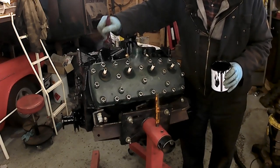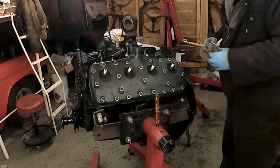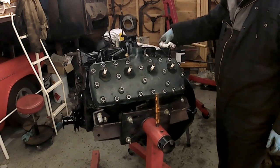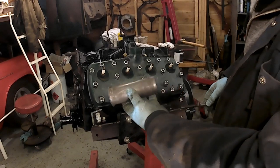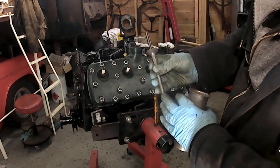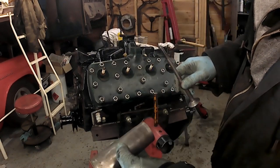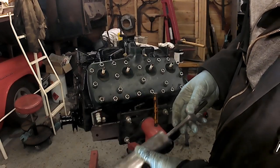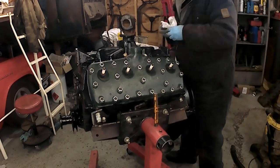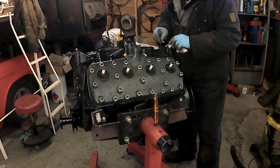They're all thick-headed bolts as well — the proper manifold bolts. Just dripped the paint all over the head — oh well. So that hole there is the only inlet to the engine, isn't it? There's the baffle and there's a pushrod. So I think I'll shove some rag down there and down there as well, just to stop anything falling in.